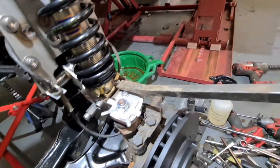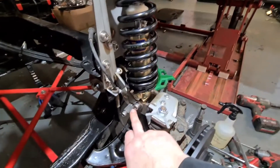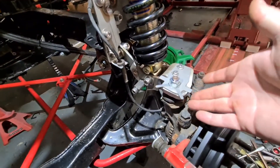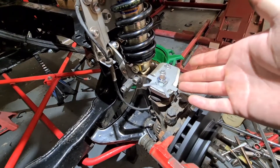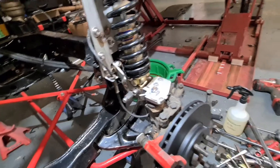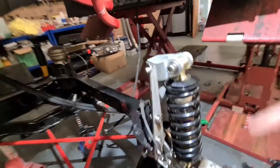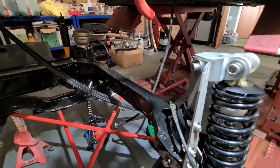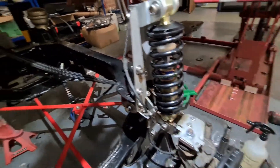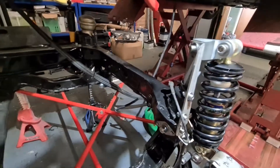He was right, it did make things a lot easier. All I did was got a lever bar underneath the collar and just levered it up slightly - there wasn't too much pressure on and that bolt just slipped straight in. Then we put the hub assembly on. I then had difficulties fitting the bump stop - I tried to jack it up but that was lifting the whole subframe. So what I did was undo these three mounts here, which meant I could lift the arm up quite freely, got the bump stop in at the bottom, done the nut up and let everything drop down.